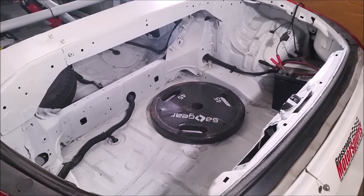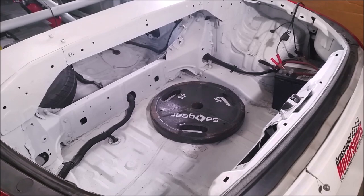I'm going to try to tuck the 45 pound plate up against that little bulkhead, but you have to check that once you drill through, you can actually get to the back of the sheet metal to put on your nut and washer - otherwise you've just drilled a useless hole in your car. Drill a pilot hole first so if you made a mistake it's only an eighth-inch hole, not a three-eighths hole. Use grade 5 hardware, three-eighths diameter, large fender washers on top and bottom, and nylon lock nuts. Take your time with this project - don't waste money, do it right the first time.